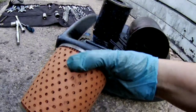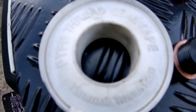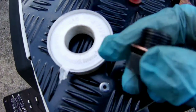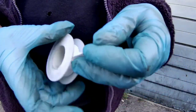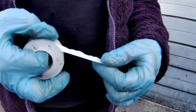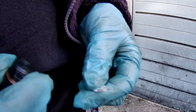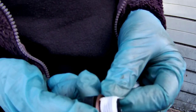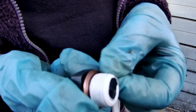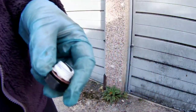This is what it should look like. Now, if you're anything like me, you'd have forgotten to buy a new crushable copper washer for the sump plug. Make sure you keep some PTFE tape handy — cut a bit off and wrap it round the thread of the sump plug, keep the old washer on there. It's a bit of a bodge but it'll stop it leaking — plumbers use it.